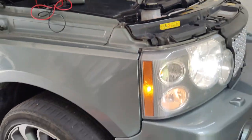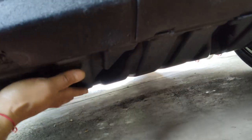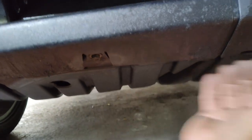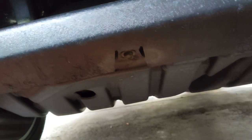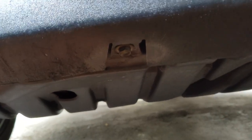There is no access to the alternator from up top — it all has to be done from underneath. We'll remove the splash shield underneath and the shield in front of the vehicle; that should give us access to the alternator and the belts at the front of the engine. I did a video on how to change the oil on these where I covered removing and replacing the shield, so I'll leave a link to that in case you need help.